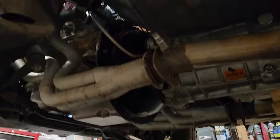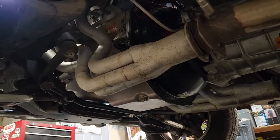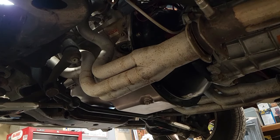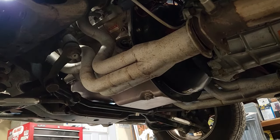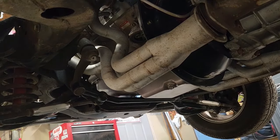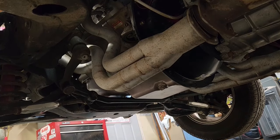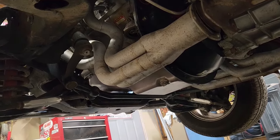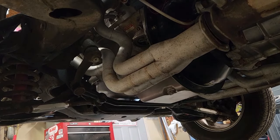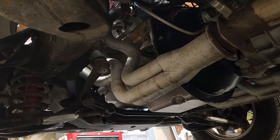And then the headers are disconnected from the exhaust. I took some of the lower bellhousing scatter shield bolts, that connect the scatter shield to the block plate, out. But the motor mount bolts are still in, mainly because there's weight on them. It's not like when you set the motor on the mounts, there's no longer any weight and you just shove the bolts through. With these steel mounts on it, the bolt is basically taking all the weight.